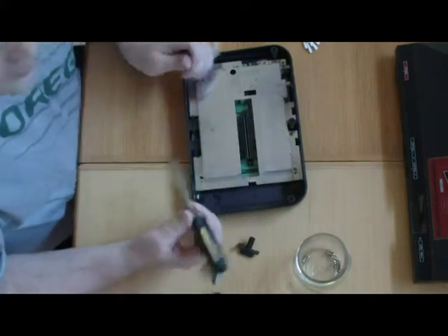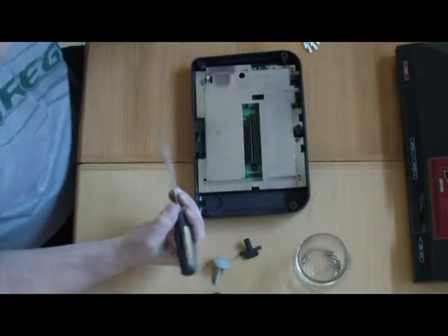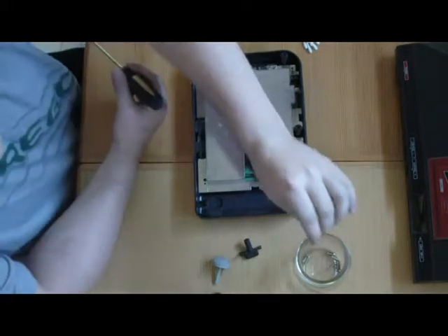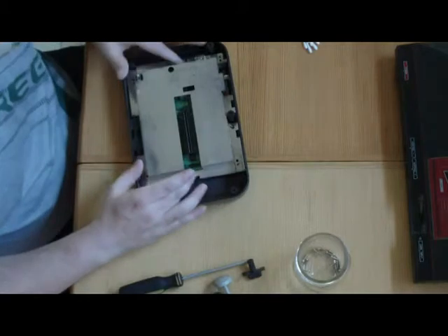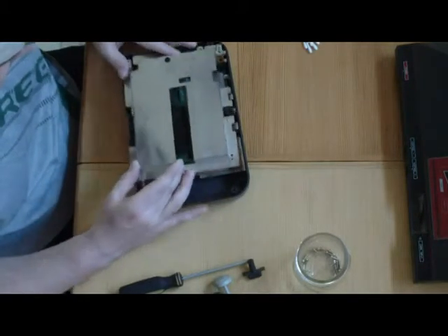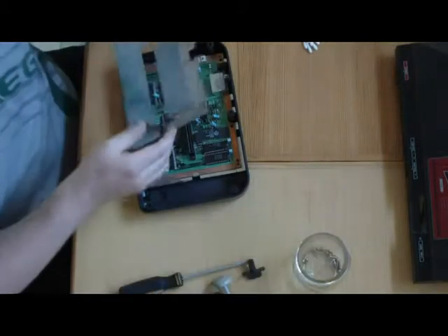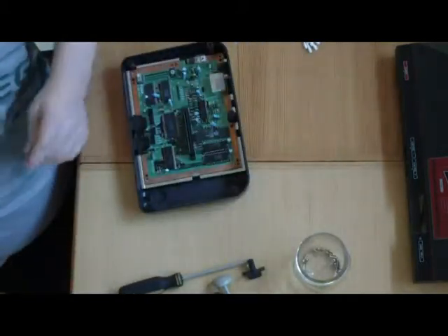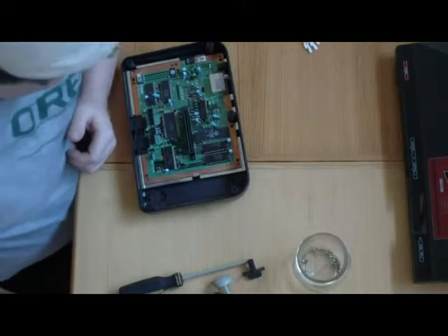Now that we're here, you want to remove the seven screws. Remember the size of the screws and what they look like, then come right back. Now that you have your seven screws removed, go ahead and remove the top plate. That can actually go in the dishwasher and be washed too — set that in the dishwasher. Just make sure to dry that part really well.